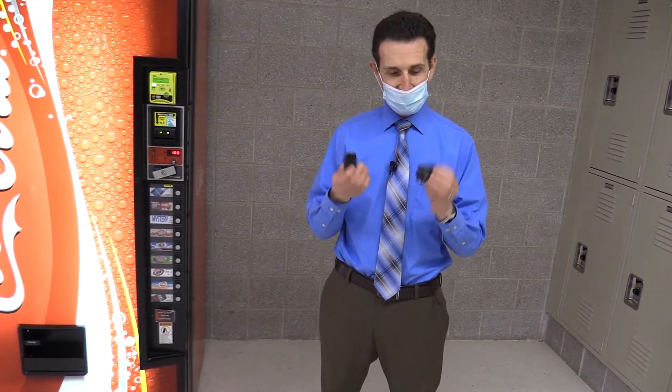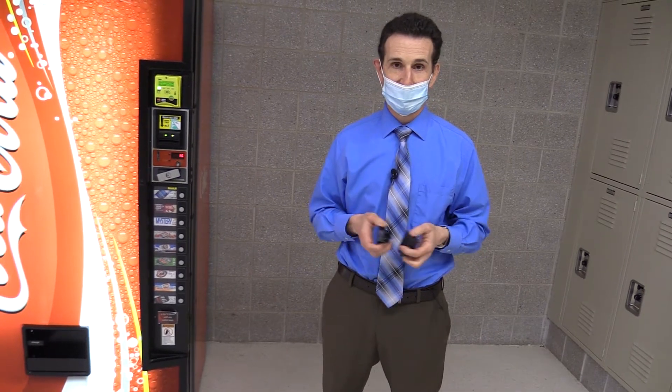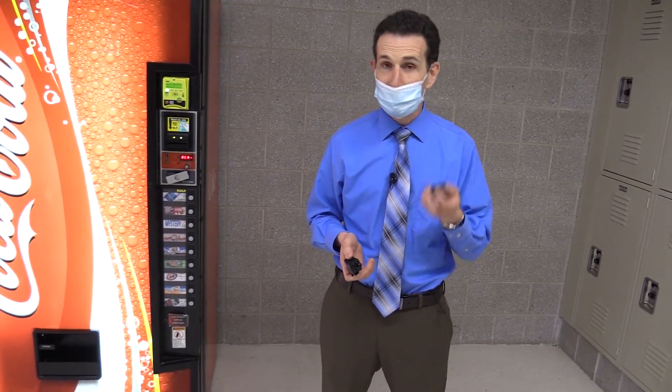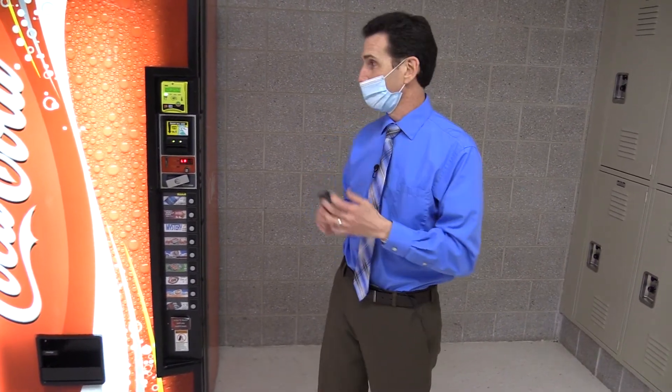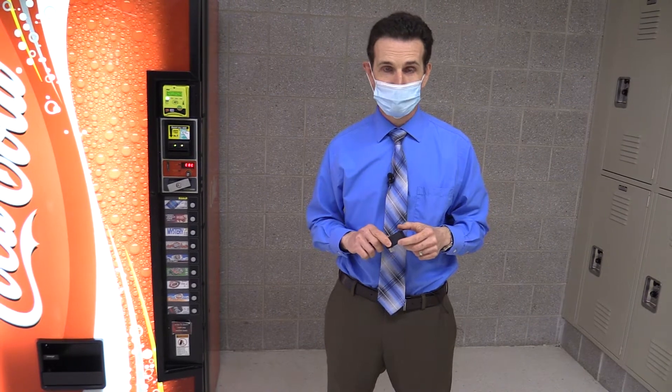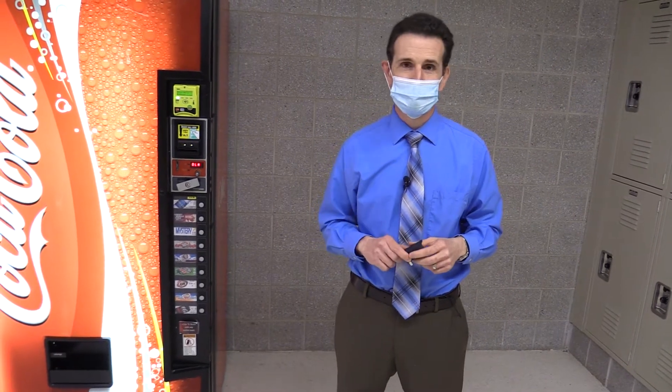The relay is doing the actual switching. These are things that often go bad in vending machines. If you ever come to your vending machine and the sodas are warm, you don't want to automatically assume that the compressor went bad. You've got to think, maybe it's the relay — the control board is telling the compressor to turn on, but the relay isn't actually switching the compressor on. So that's one of the first things that I check in a vending machine.